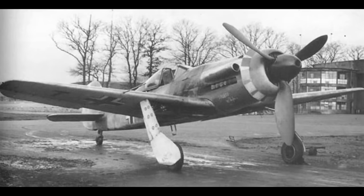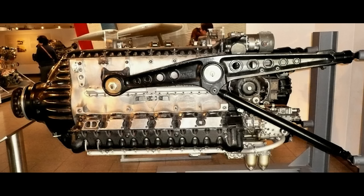That just about covers the engine stuff. In summary, we have a mediocre engine with 35 liters of displacement. However, it's force-fed with an advanced dual-stage 3-speed supercharger blowing through an aftercooler, which is further supplemented by a good MW50 system and at least two stages of GM1, aka nitrous oxide. I should clarify what I meant by mediocre. The Jumo 213 was a bit heavy, and it didn't have four valves per cylinder, and it had that issue with the valve stem blocking the exhaust port.